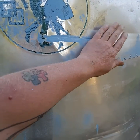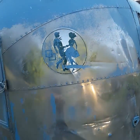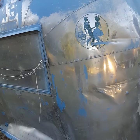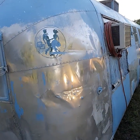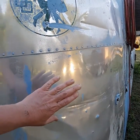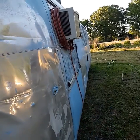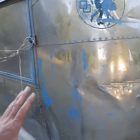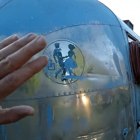This right in here I think I'm gonna have to live with, because this one panel right here is like 600 bucks — yeah, it's stupid what it costs to get these panels. But this one here, if I can just get this gauge aluminum, all I need is a straight piece this size, rivet it, bend it around, rivet it — because it's just this one bend, it's not multiple bends.